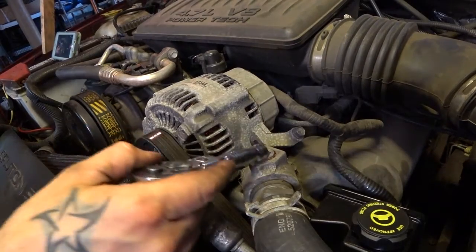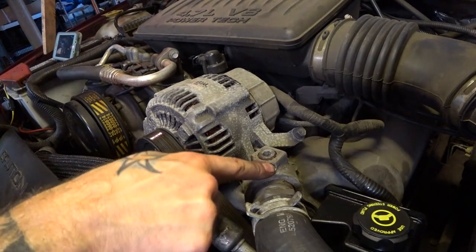Among other things that are strange and a little annoying about this particular V8, it does not have a normal cooling filling procedure. You have to bleed it using a provided bleeding port — this guy right here at the end of your upper radiator hose.